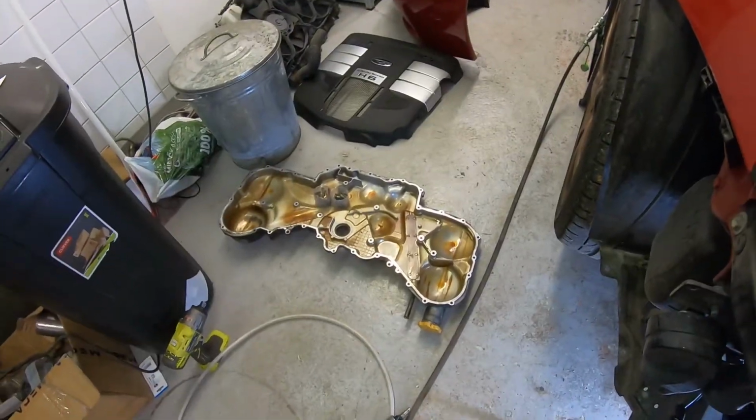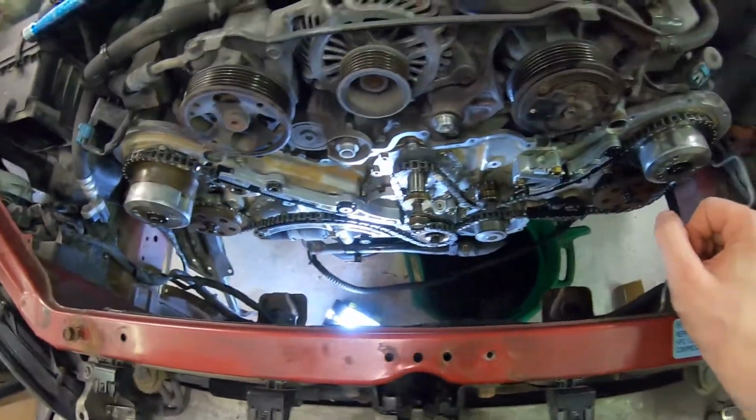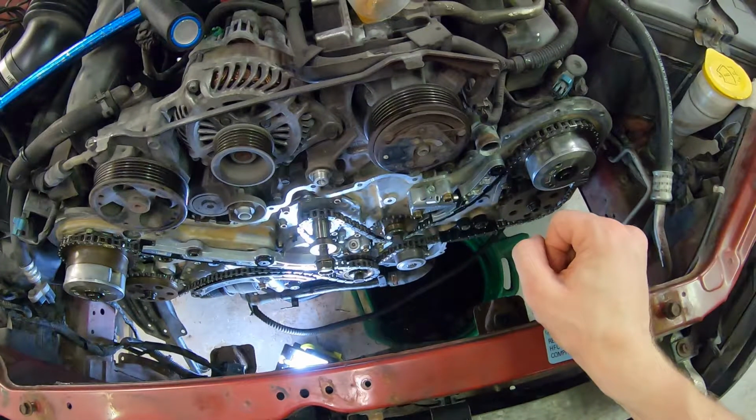So there. Now it's time for the valve cover. No, sorry. Front timing chain cover. Now, before we move on to the outer timing chain cover, remember to lubricate the sprockets and splurge some more on the chain guides while you're at it. You know, just for some good measure. Alright then, I will just go ahead and unpause the video for you.